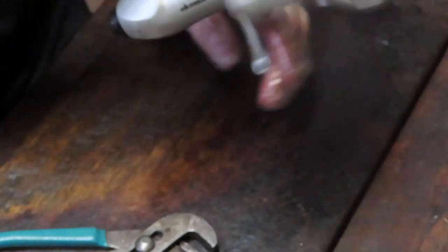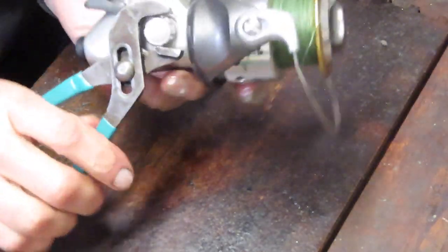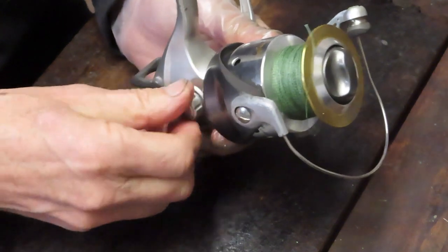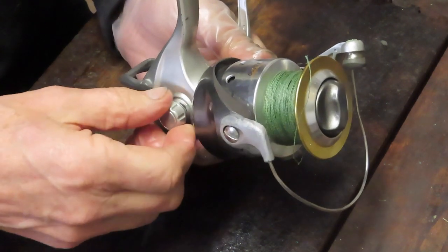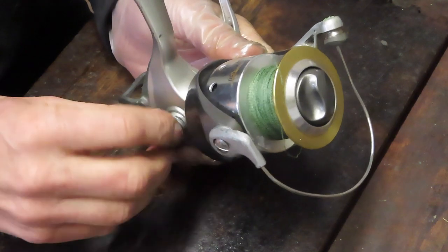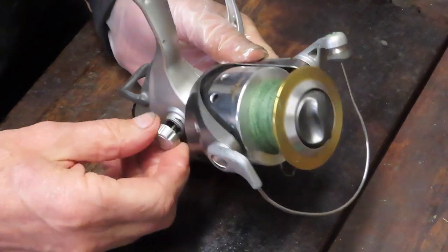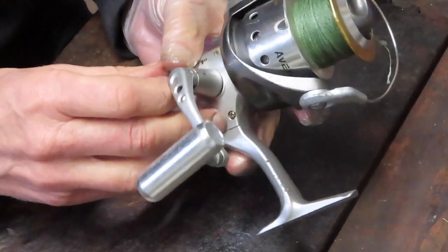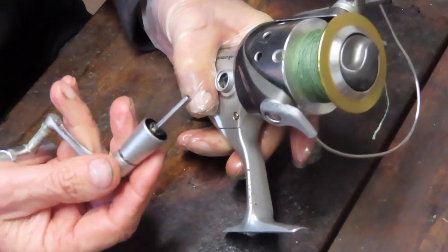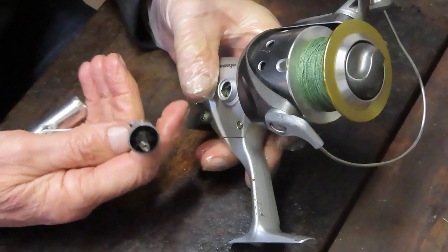We're going to start by removing the external pieces. The first thing I notice is that this cap is turning — when that cap turns it means the handle goes through and you have to remove the cap from the screw. Somebody over-tightened this one pretty seriously, but I just use pliers to get it started. Those of you new to my channel, I'd ask you to subscribe. You'll see me work on all kinds of fishing reels — spinning, bait feeders, bass reels, ocean reels. If it's a fishing reel, chances are you'll see it on my channel.